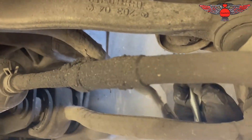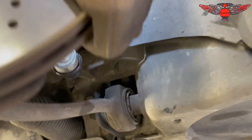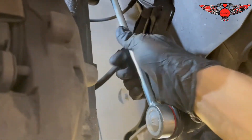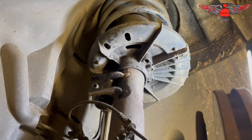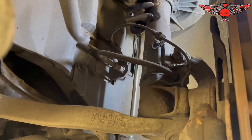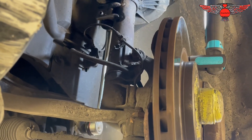Now we have our new link. Just feed it through the bottom there and through the top. Put your nuts on — it can be a bit fiddly but you can just adjust it to fit the hole up there and then get the nut in. Pretty much you get the idea of what we're doing here. Now we just need to tighten these 18mm nuts — again, hold the center, but it will be a lot easier because there's no corrosion. Hope this video helps; don't forget to subscribe and like my videos, and we'll see you on the next video.